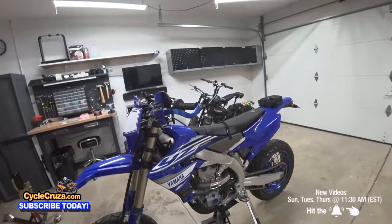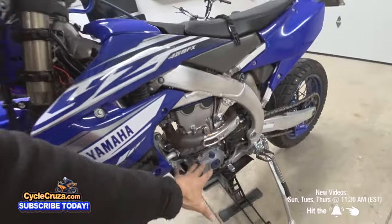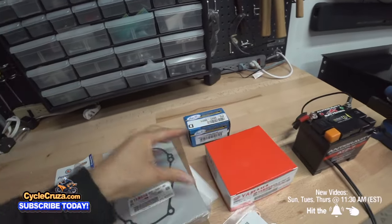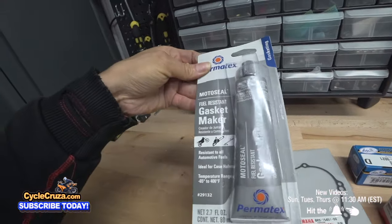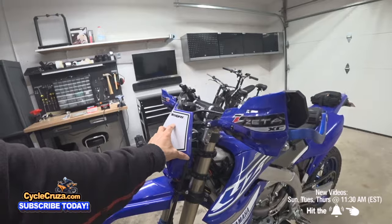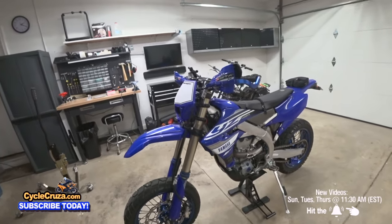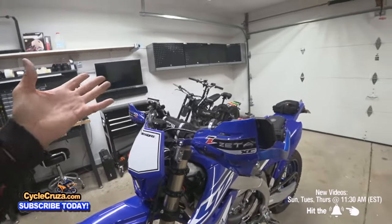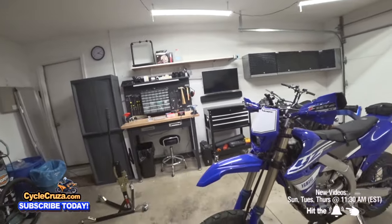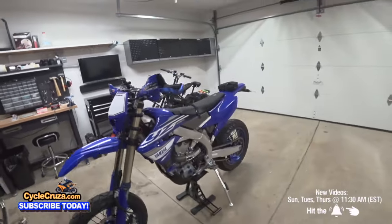To remedy that situation — the WR450F version of this bike has a stator that supports a headlight because it comes with one from the factory. So what I need to do, and I have the parts for, is upgrade to the bigger stator rotor. I have the part number, the gasket, the Permatex gasket maker sealant, and a flywheel puller. I'm going to install the bigger rotor and do an install and test video for you. Meanwhile I just turn the headlight on at night when needed — technically in some states it may be illegal to ride without a daytime running light, so I do need to get that sorted.